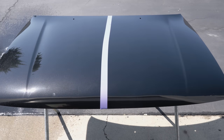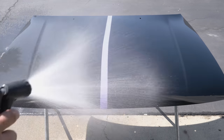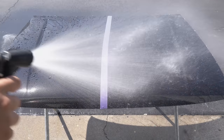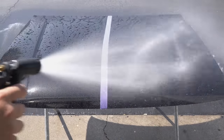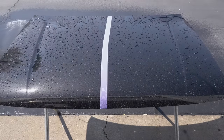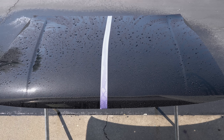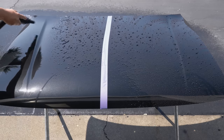I have a piece of tape down the middle because I'm going to show you how you could remove it with either a machine or by hand. I just really want to show you that there's actually a seal and shine on the panel — it's a fresh coat of seal and shine. It hasn't degraded at all. You really want to try to break down the coating as much as you can. You really don't want a fresh layer to work with because that's when it's most durable. So you really want it to be degraded a little bit.